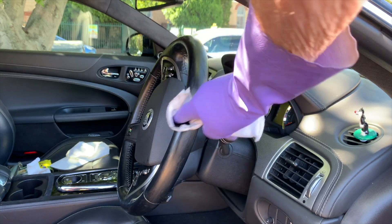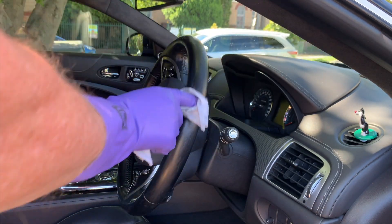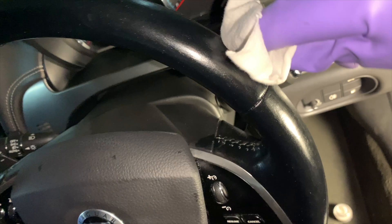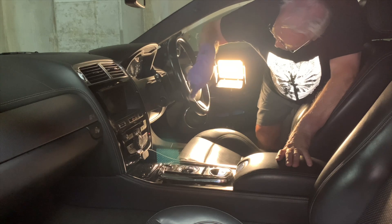Lightly smooth the color onto the wheel in long strokes and as thinly as possible. The color dye dries really quickly so you can apply a number of coats in one sitting. Try to fill the gouges with the color dye, but not too thickly this first time. If you wipe over areas you don't want to cover, the wet cloth will remove the color immediately — water will even remove unintended marks after a few minutes, and your hands and brushes will wash out with water too. The color dye dries to the touch quickly, meaning you'll be able to drive the car back to its parking spot after about 30 minutes.